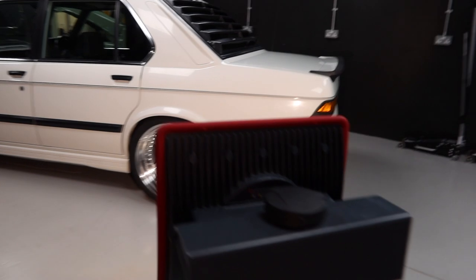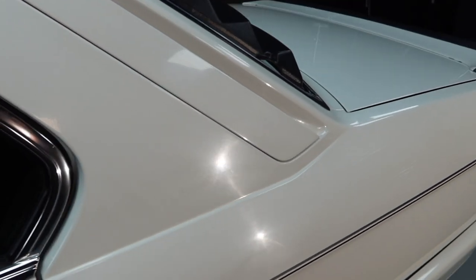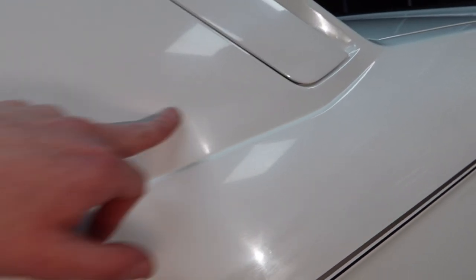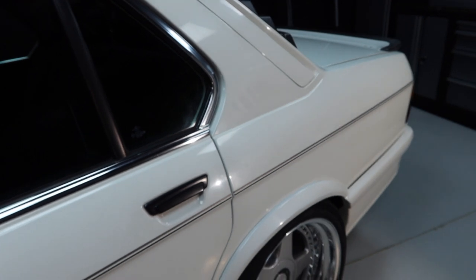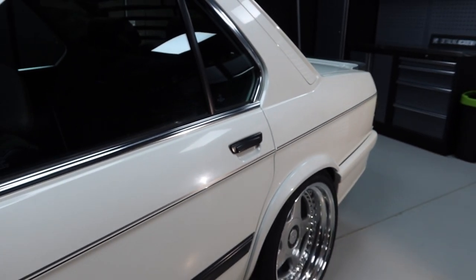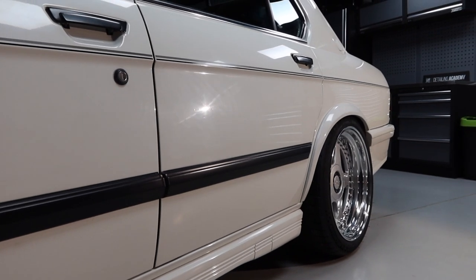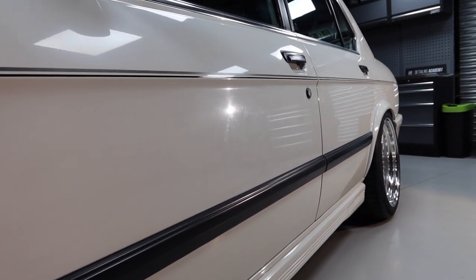If we position the light here we're going to be able to see that reflecting off the rear quarter. You can probably already see just how bad this paintwork is. Now it's not the end of the world - this will clean up. There are quite a lot of DA marks in it here actually. We've not gone around this with a paint depth gauge yet to see if it's had paint. I would say by down here it looks like it probably has - looks like it might be a blowing line here as well so we're going to have to keep an eye on that. Visually inspecting the paintwork, there's nothing that I really worry too much about. I don't think it's had any big repairs. Sometimes when you're actually detailing a car and you get in close you notice some bits that maybe you didn't pick up just washing it or when you look to buy it. That doesn't bother me too much on older cars - I can forgive them having the odd knock or scrape fixed in their time.